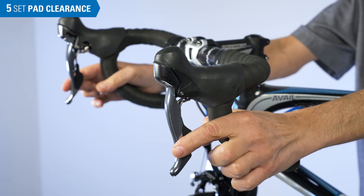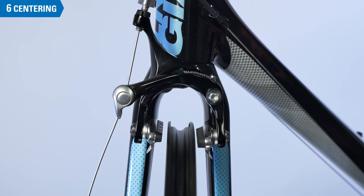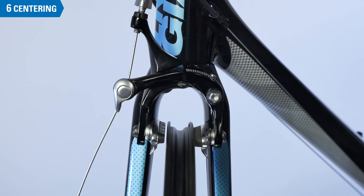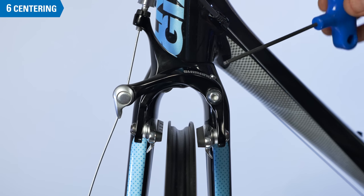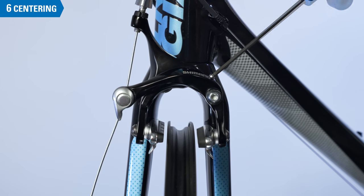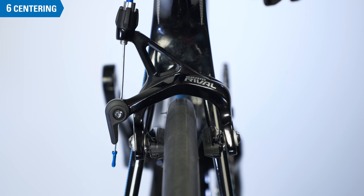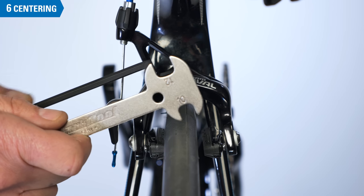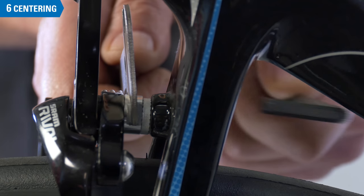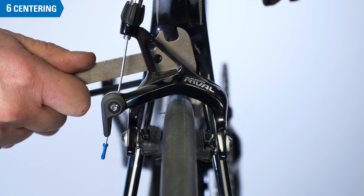Normally, the front and rear brakes are set to feel the same. We will now center the pads to the rim. Depending on the model, there are different techniques to do this. Some models will have a centering screw on the side — use the screw to move both pads left or right. If the brake looks centered, it is centered. Some models lack a centering screw; in this case, we move the brake with two wrenches — one on the centering flats and another wrench on the mounting nut. Move both wrenches the same direction and the same amount.